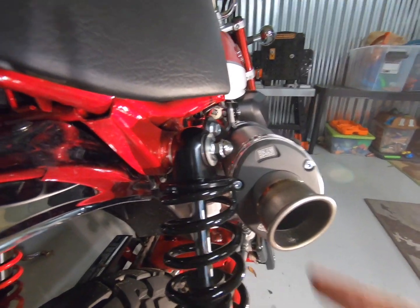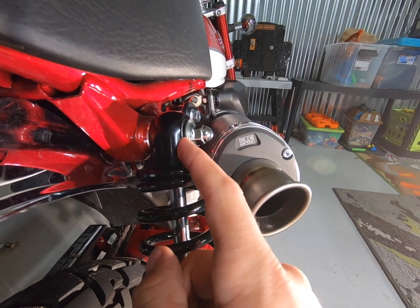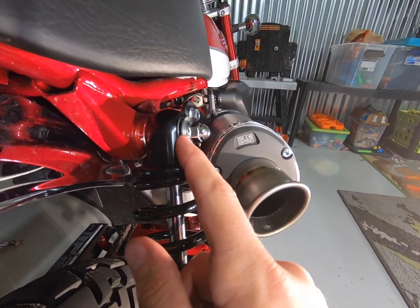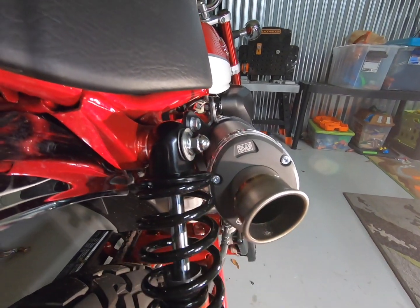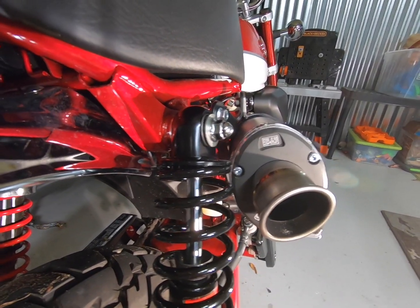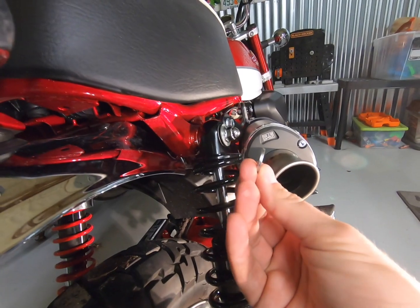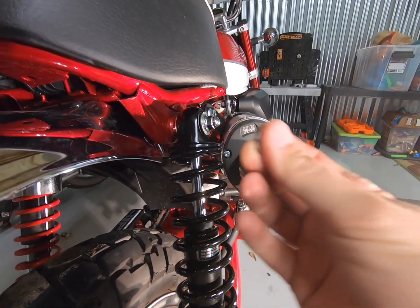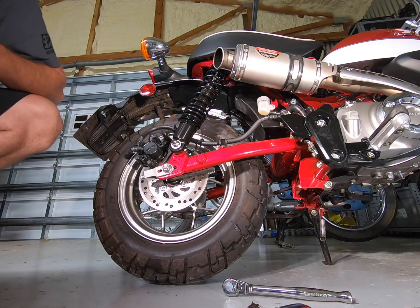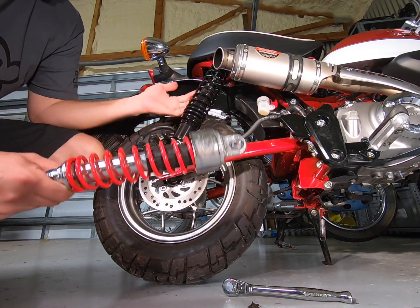On the bottom, the stock setup only had one flat washer, so we're fine there. On the top there's a discrepancy — OEM setup had the inner washer, the shock eye bushing, the outer flat washer, and then a thicker smaller washer before the acorn nut. I'm going to delete that thicker washer. One washer is enough, and all my racing experience tells me if the second washer is not a lock washer or beveled or cupped, it's not providing any pressure to keep the nut on. And there you have it — the shock is on. Simple process, a matter of minutes.